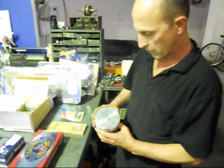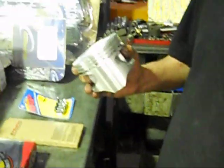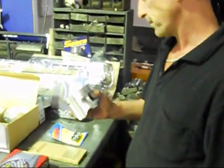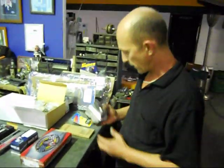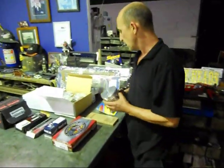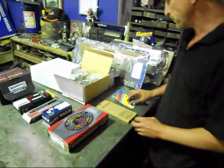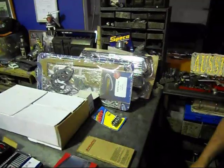We've got flat top pistons. This is basically a HZ — a pollution red motor, 308, 308 cubic inch. It's a Holden for those people that aren't Australian — basically General Motors — and that's what we call Holden in Aussie land. It's a 308, 5-litre V8. Basically a 4-inch bore. So it was 4 inch and 30 thou, now it's 4 inch and 60 thou to clean it up nice and parallel. That brings it out to about 317 cubic inches with the standard crank stroke.